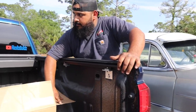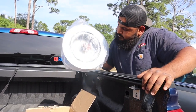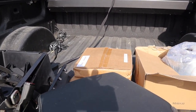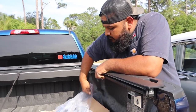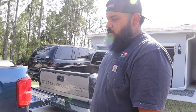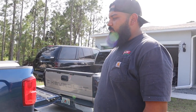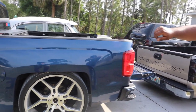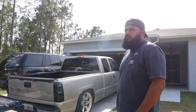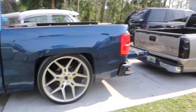Sorting out the parts with Alan — the fronts and backs. The fronts are the smaller boxes and the backs are the bigger ones, probably because of the hub size. We discussed whether to take the caliper completely off or leave it. Alan explained: you only have to bleed the brakes when you disconnect the brake line hose from the caliper, because that's when air gets in the system.